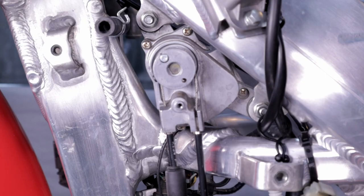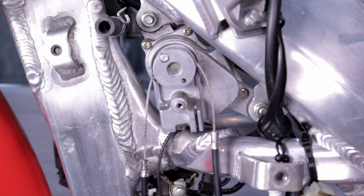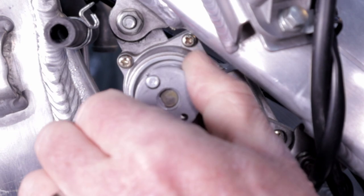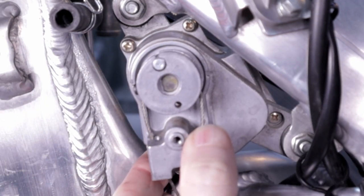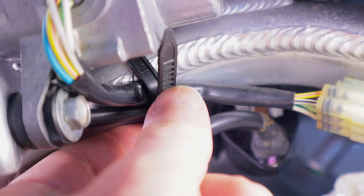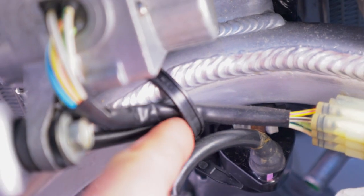The next thing to check is the operation of the servo. To do that, remove the cables from the servo body so they're loose, then rotate the servo by hand. This should rotate fairly easily with very little resistance. The servo body and servo motor should not be pulled down by the cables at all once the cables are installed and tightened to specification.